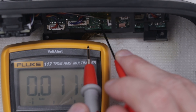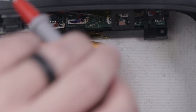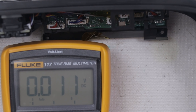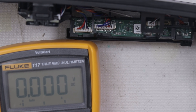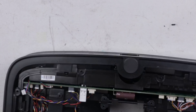We will now inject voltage onto the pin that's supposed to have voltage — the one with the dot. 1.4 volts with the magnet attached and 1 volt with the magnet not attached. That is similar to the other reading we got — even though it's a higher reading, the other vacuum was 1.1 and this is 1.4. So when I put the magnet underneath, the voltage goes up instead of going down like the others. That theoretically shows the sensor is probably working normally on the other vacuum. Now with the bumper on, I can get the rest of it back together enough to test. Hopefully this one will work.